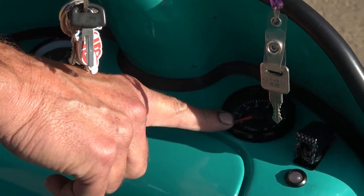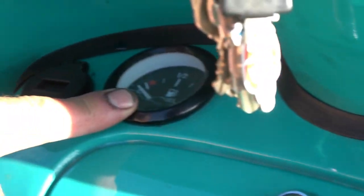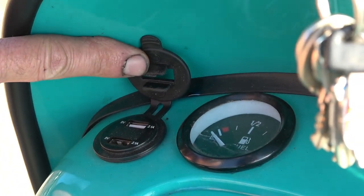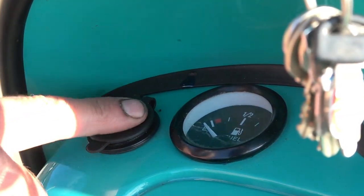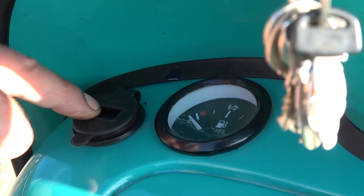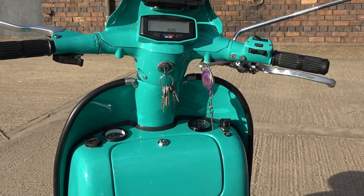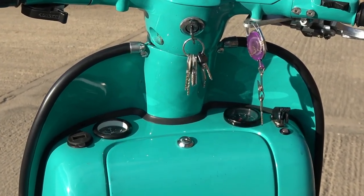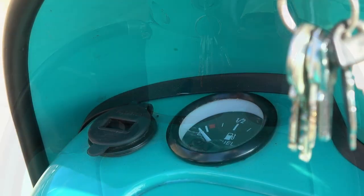One of Anthony Tam's speedos. I've got a fuel gauge in here as well — this is a smart little bit of kit. It's got a couple of USBs, and in the hole in the middle it also displays the voltage currently coming through. When the engine is running, if you can see 14.4 volts or more, you know you're getting a good charge into the battery.